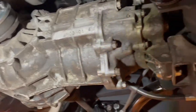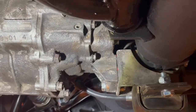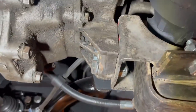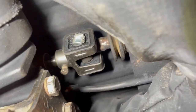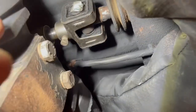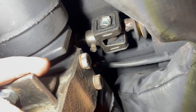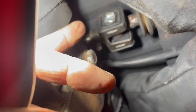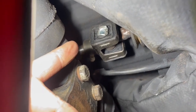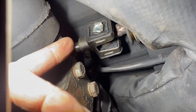There are more ways to do this, but I use a completely simple approach. This is the original Type 2 transmission mount cut down with new holes to fit the front mount of the Type 1 transmission — this one with the three bolt system. You can use the stock shift linkage if you do it my way. If you don't, you have to make the linkage a little longer because the transmission hockey stick is a bit shorter than the Type 2. I leave it with the stock one because when you're out driving and something goes wrong, you don't have to worry about a custom shift linkage — it just bolts on as-is.